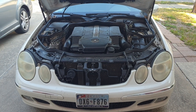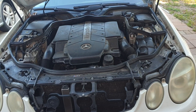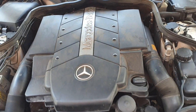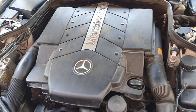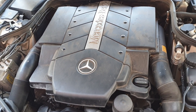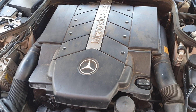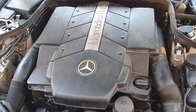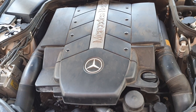I'm going to check the top of the intake manifold to see if I can spot anything visually, as far as the two lean engine codes are concerned. I'm getting P0171 and P0174.